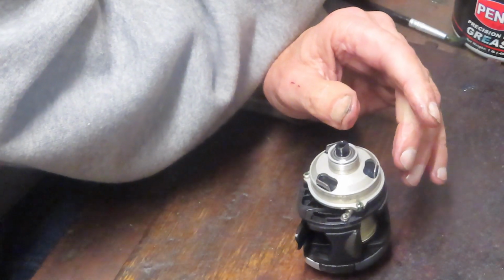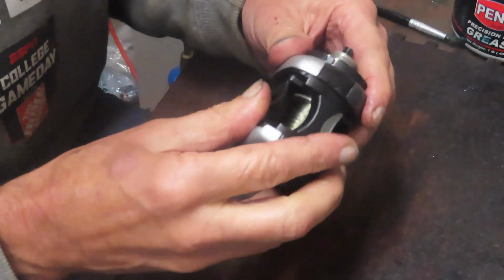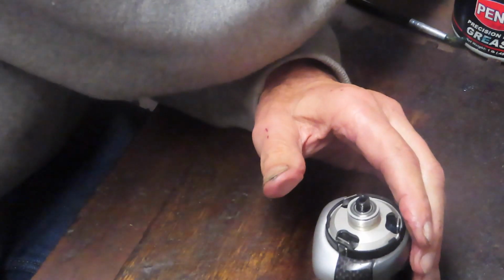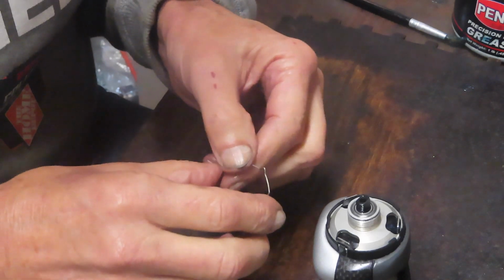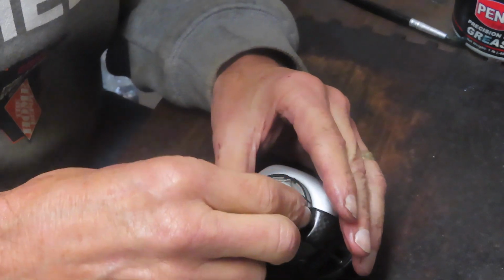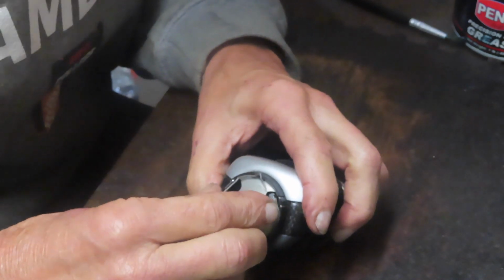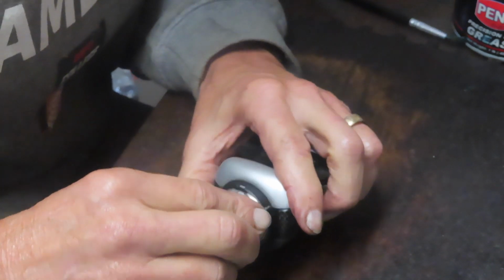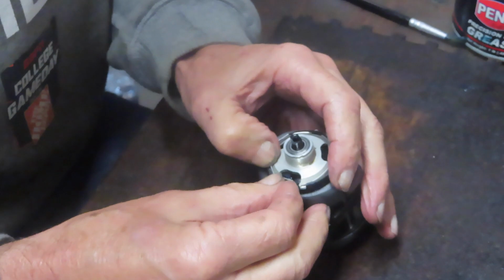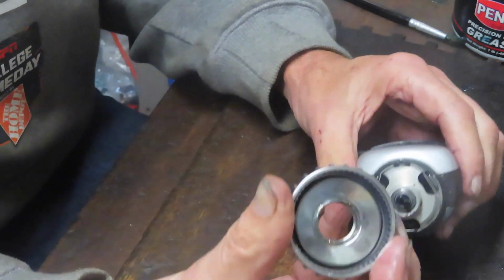Alright, looking on the outbound side then, the bezel comes next. That should just press on there. That was a nice snap. Then we had that click ring come. Just need to find the insertion point for that. It's over here. Like that. And then we just hook that under the 2 tabs on the other side. That's our click ring. That's what's going to make the noise on the inside of this carrier.